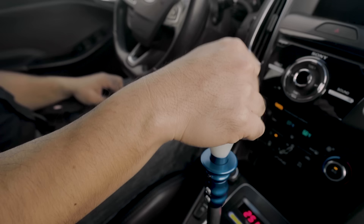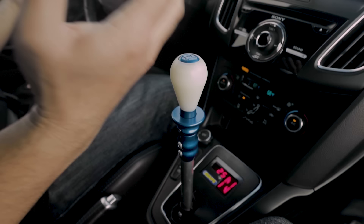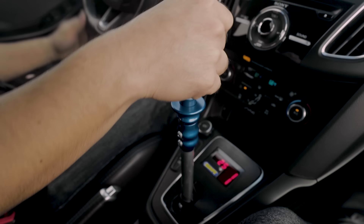It's almost instantaneous. So if I go down to the shifter — we're currently in neutral, I'm on the clutch — if I go to first gear right now, we're not moving, so the output shaft of the transmission isn't spinning because our wheels aren't spinning, but our engine's at idle. When I go to first gear, those shafts are going to need to match speed. And there you go, that's the dog engagement.